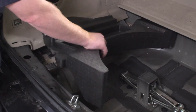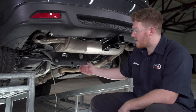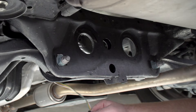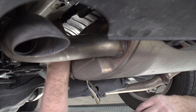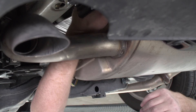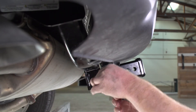Now that we are done in the cargo area, we'll go ahead and put it back together. Now we are underneath our vehicle on the ramps and we'll show you how to get your four-flat harness back to the receiver. Our four-flat wiring comes down right behind this cross member — we'll bring it up and over. Our best and safest route is to bring it over the heat shield so we avoid the exhaust and avoid damaging our wire. We're just going to bring it right above here and follow the heat shield all the way to the end, and it'll come up right here next to the hitch.